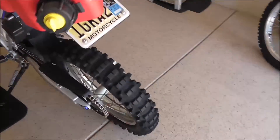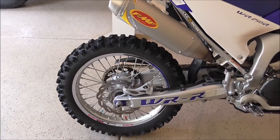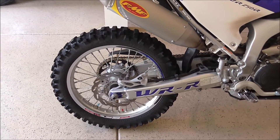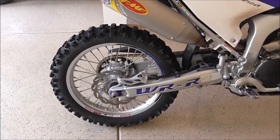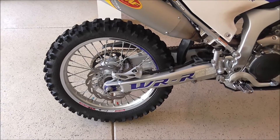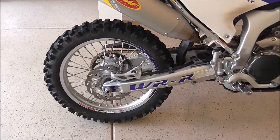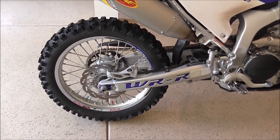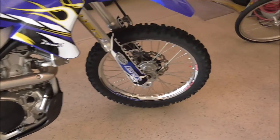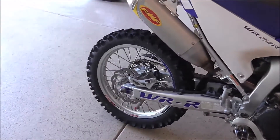I wanted to leave with new tires. Also, when you install the tubeless tire system, they will tell you to use brand new tires if you're using a standard tube system. The reason for that is the rim lock on a standard tube actually crimps the bead of the tire. When you remove a tire that's had a standard rim lock on it, there's a crimp in there, and that crimp will definitely cause problems with the tubeless system creating a seal. When I took the old tires off I could see the crimp — I even heated the rubber and it's not going to work. Purchasing brand new ones guarantees success.